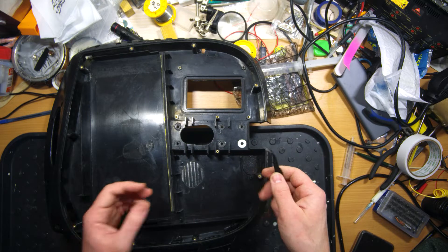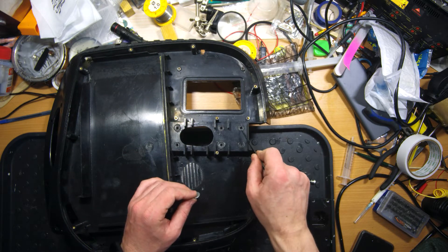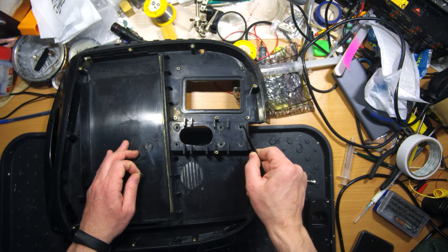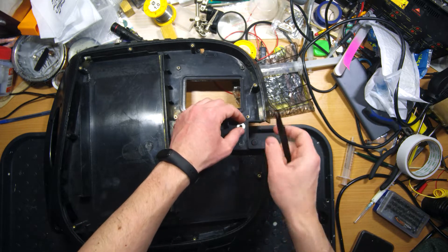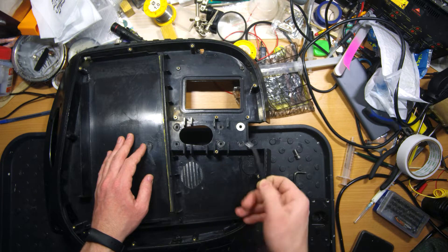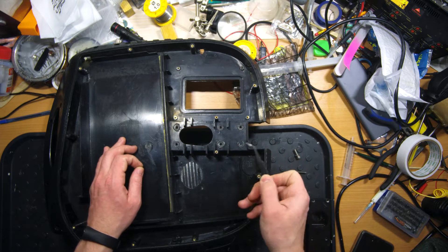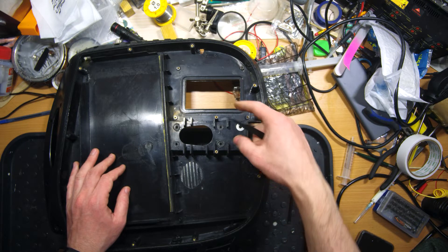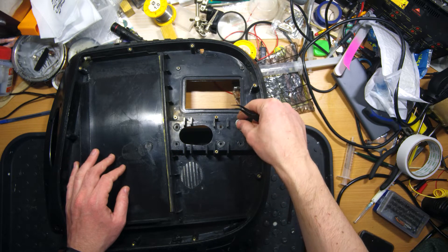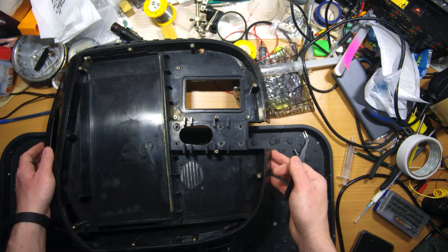So how am I going to fix that: first I will apply big washers, but before that I must align this surface. I'll clean up these areas from thread locker remains, then put melted polymorph plastic here, put the washers on it, and screw it down to the adjacent surface. After it cools down I will remove the washer, check the surface, and if satisfied I'll put the big washers back. Then I'll continue reinforcing this part of the inner shell with extra plastic, doing as much as I can, because this part is already starting to deteriorate.